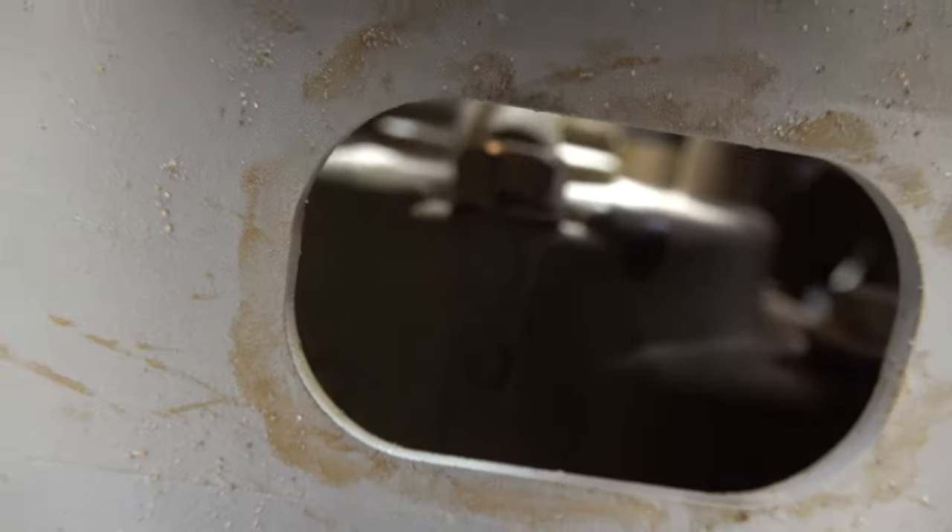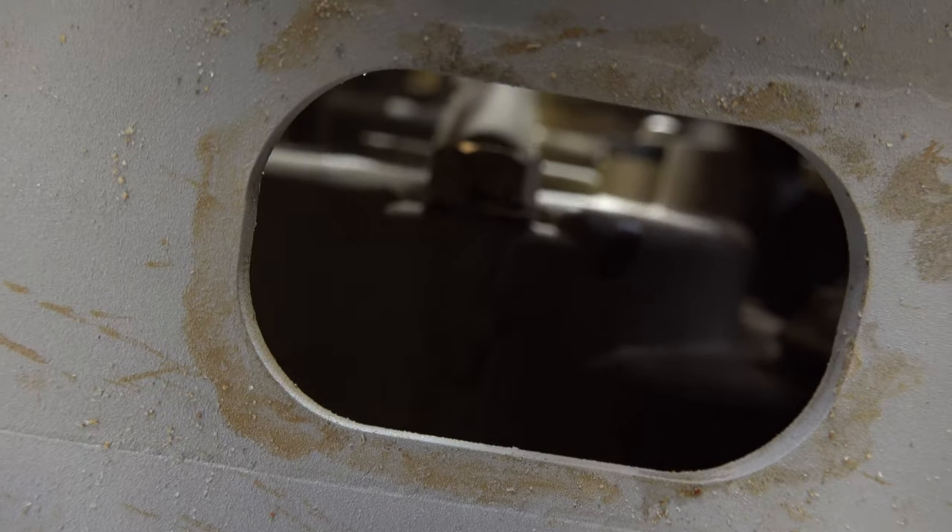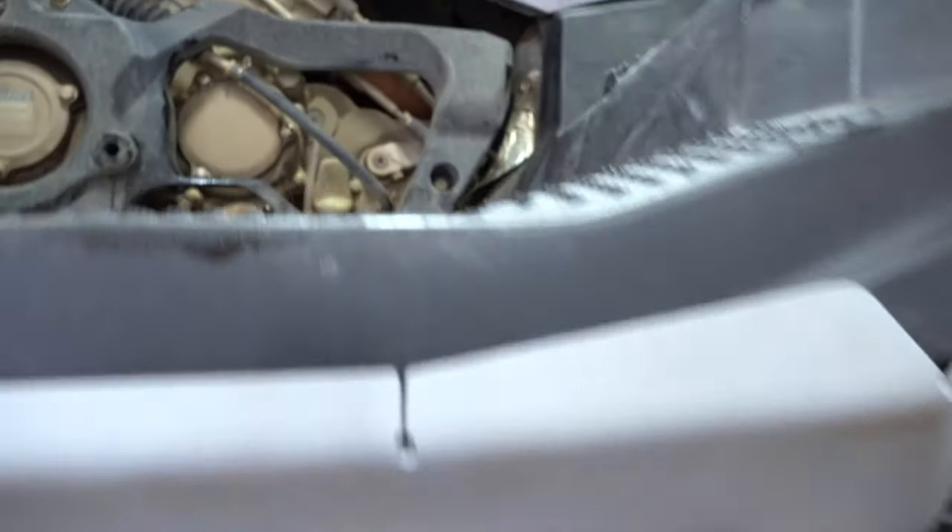The transmission is here. It goes in at an angle sideways — it's a 17 millimeter. That bolt is sticking out to the side there. If this skid plate wasn't in the way — which it's not on the stock skid plate — you'll be able to easily get to it. Remember, it's going to shoot out to the side towards us, so try not to get that on the camera.